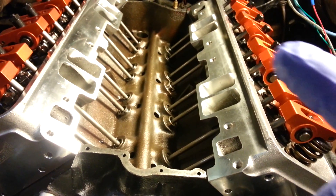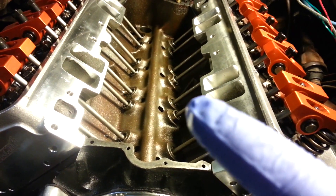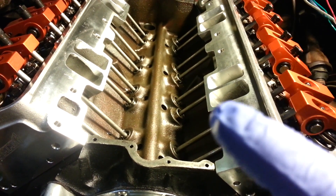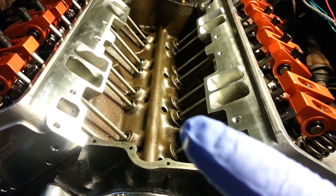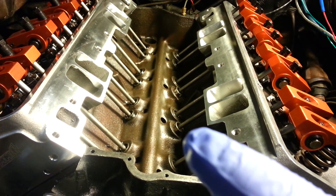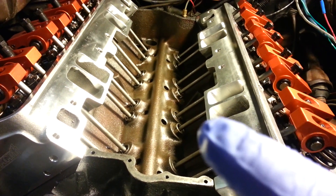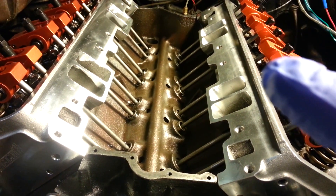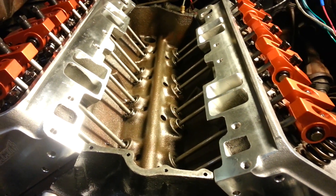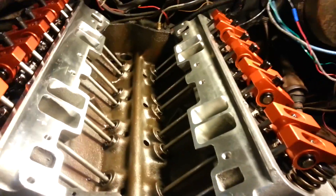That sounds kind of confusing, but on this one here — when this exhaust opens up on this side, the lifter comes up and starts to get about halfway open. Then you can set the intake because it will be fully closed on the back of the base circle of the cam lobe, so you're at the right position. You're not going to interfere with any of the cam lobe journal traveling. Then the intake is going to close, which this lifter will come down. And as the intake closes, you set the exhaust. E-O-I-C: exhaust opening, intake closing. I'm going to turn the engine over a few times using a breaker bar and we'll see these things in action.